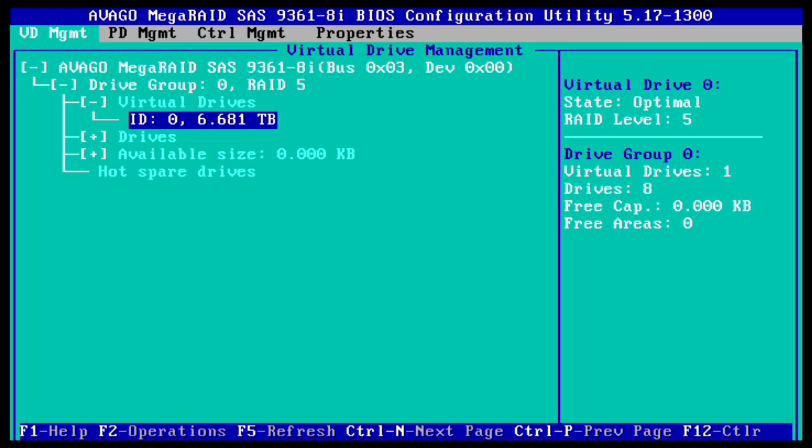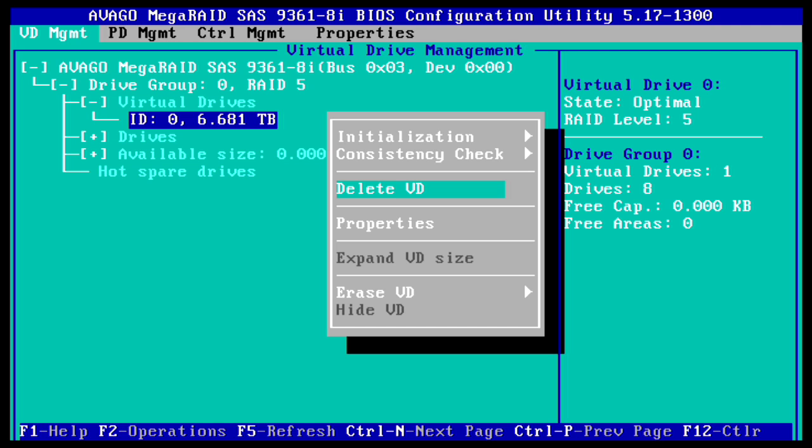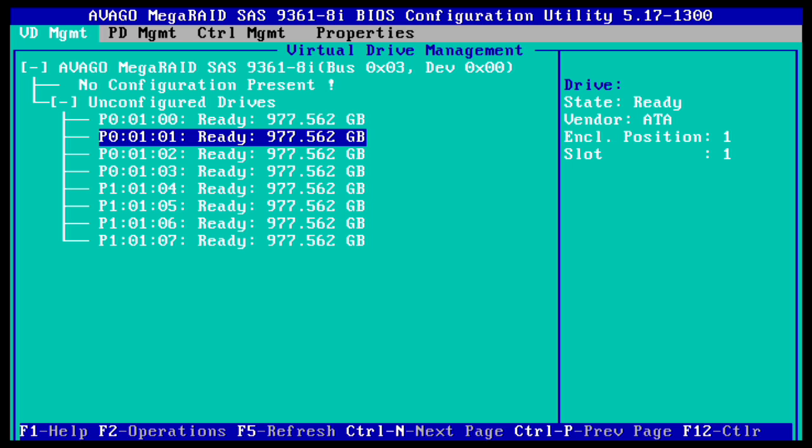The hard shutdown caused the RAID to start beeping and some of my drives weren't even showing up — I thought I'd fried them all. Luckily I didn't. From the ASUS software BIOS I did a secure erase, and then they showed up. Right now using the up/down arrows you can see I've already got a RAID 5 set up using virtual drives. A good habit — thanks to Richard Keats from Cinesis — is to label each drive as you plug it in, so you know which one to pull if you need to rebuild.